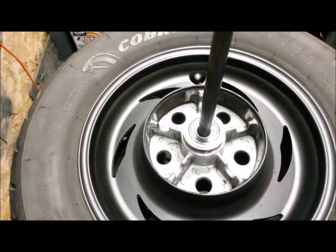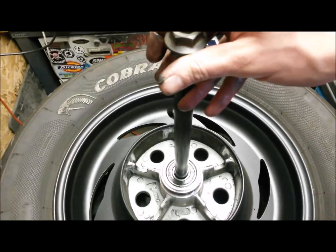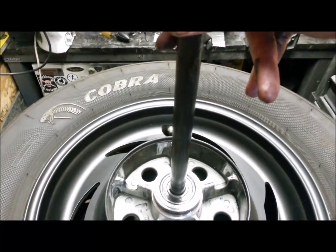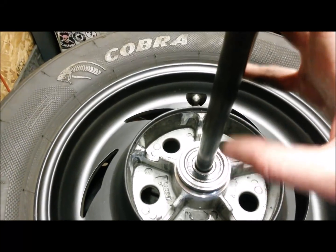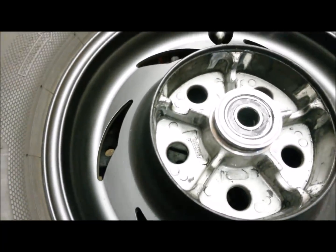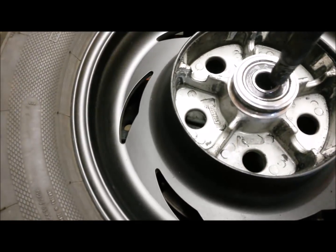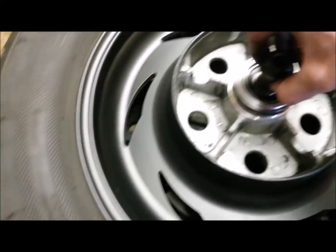You can put the axle down there, slide the bearing over the top and tap it down, a bit like it would if it was a steering head, with your bottom yoke going through, and just slide the old bearing or something down there to touch the outer race, and that will keep it all in line. But as I say, if you're careful just tapping it down and don't go mad all the way, just manipulate it into place, and then the final few taps will be enough to line it all up. There we go.